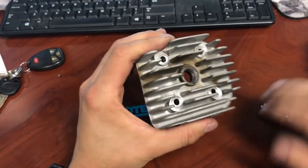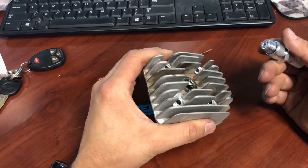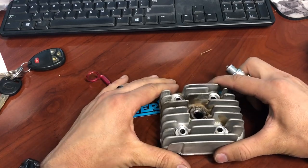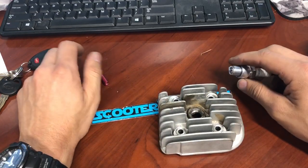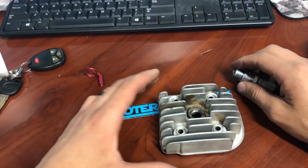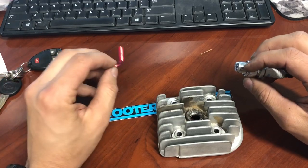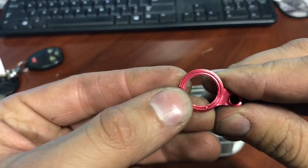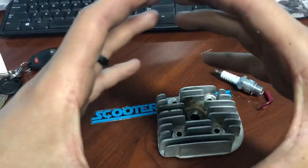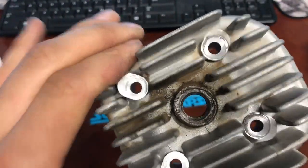It pancaked the ring and it never sealed. Everything looked good, the spark plug was on, the bike ran great when it was cold — but the hotter it got, the worse it got. I used to run that bike at 330 degrees, and within five miles of one ride it shot up to 410 degrees. The ring was just tightened down too much — it crushed and pressed flat, widened out, and when it widens out it doesn't seal right.